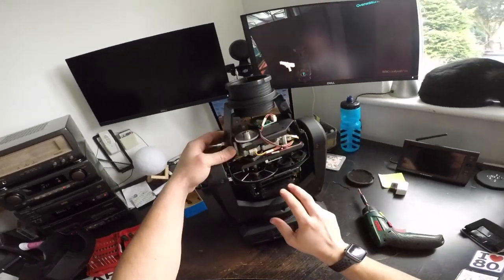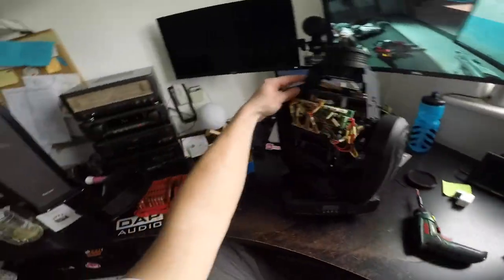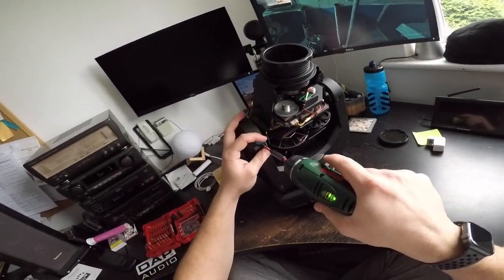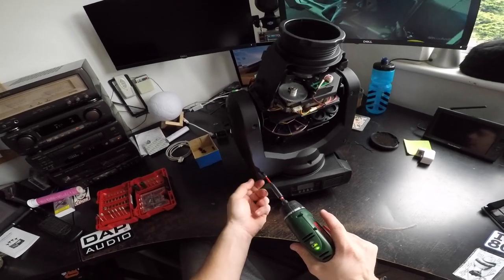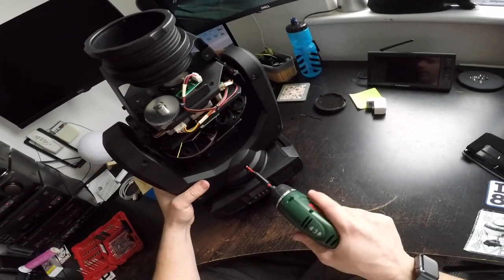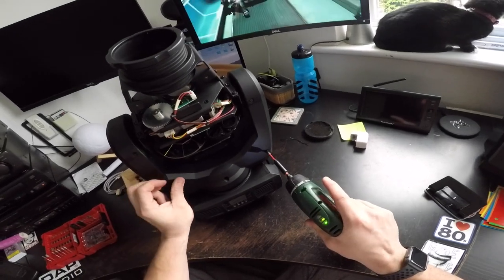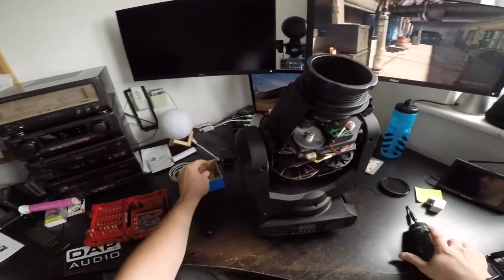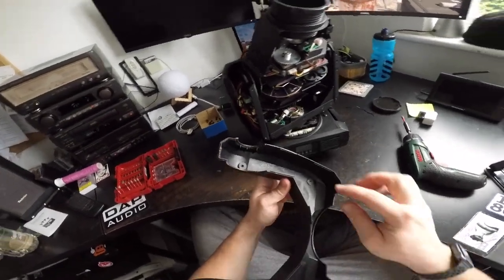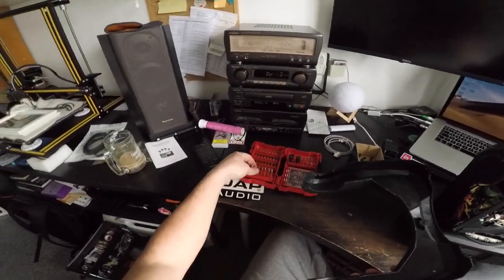To disassemble, you saw these four screws on either side — these come off. This shell comes off and then there's a further five screws per arm here. This is the eighth one I'm doing so I'm getting really fast and pretty good at this. All this haze fluid kind of recondensates in these and creates havoc really.